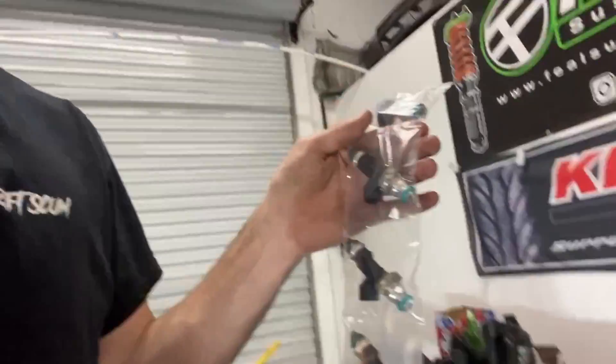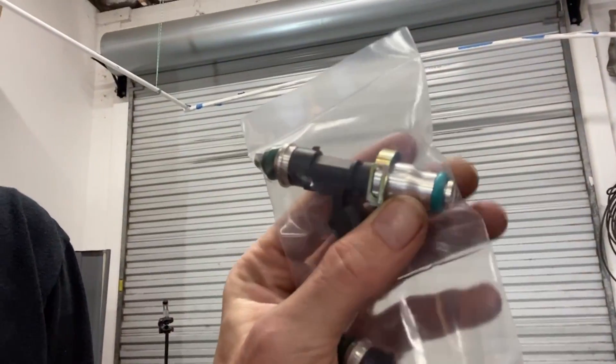Back in the shop with a huge bag of clean injectors. I took them up to Matt at Evolved and he tested them to within one percent of each other — very clean. We replaced the O-rings with E85-safe green ones, and he gave me an extra bag just in case. For now I'm calling it fixed, but we'll keep an eye on it as a wear item. If I'm driving it all the time it might not be an issue — we'll see.